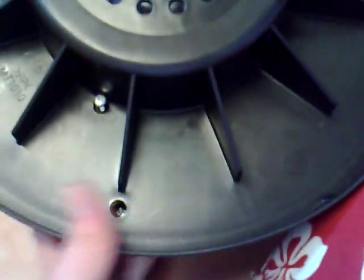If you need to get access to the motor, put the rewind back on so you don't get grease on your floor. Position it until it goes in, then turn this upside down again. You can remove these three screws — one there, one there, and one there. These are slightly difficult to unscrew, so I've already partly unscrewed them. These screws come out, unlike the other four screws which stay in most of the time.